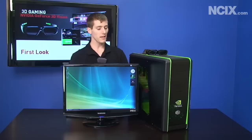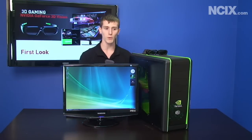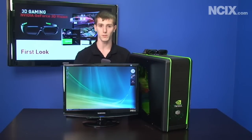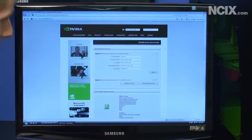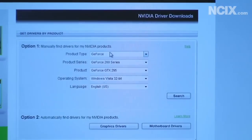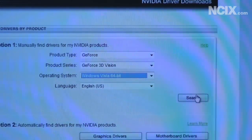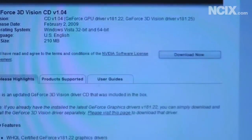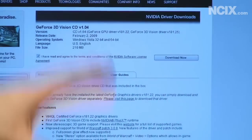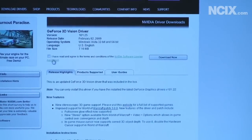The last thing you will need is an NVIDIA qualified video card. We're using a GTX 260 here for demo purposes, but NVIDIA recommends anything over a 9800 GTX Plus. To set up 3D Vision, go to the NVIDIA driver download site, navigate to GeForce then GeForce 3D Vision, select your version of Windows Vista, and click search. It gives you an option to download the whole package, which is 210 megs, but the actual 3D Vision driver is only 7 megs, so you can just click through and download that.